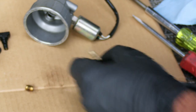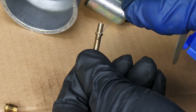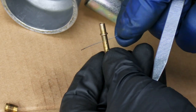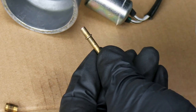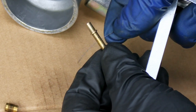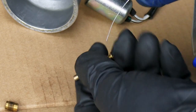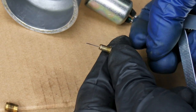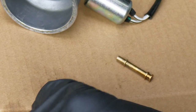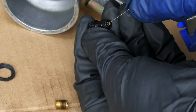On this emulsion tube, you'll want to do the same thing. Use these little different sized rods to go through every hole just like so. After you do that, blow some brake cleaner or carburetor cleaner - whatever you've got - through those holes and then follow that up with air. Go through every one of those. Go through the middle. Go through your main jet - make sure that's clear, blow that out. Do the same thing with that - make sure that's all clear and then blow it out with air.